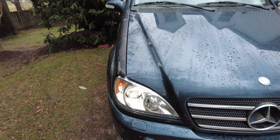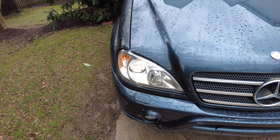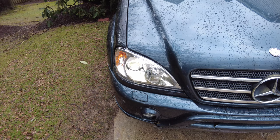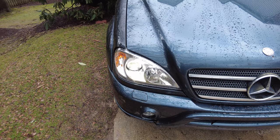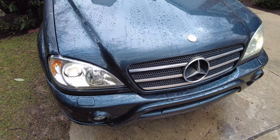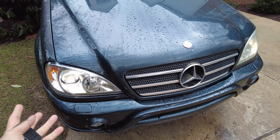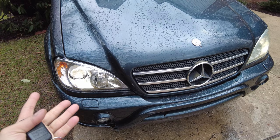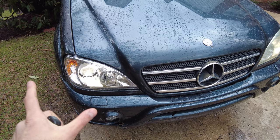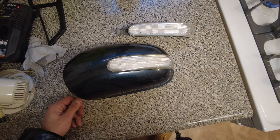When I swapped the good headlight over to this side it still wouldn't turn on, so I knew it couldn't be the ballast. The Xenons don't have a fuse — they come from the AAM module — but I tested the connectors with a multimeter and they had power. Finally I dug in further and saw on the ground wire there are two ground connectors and one of them was for the Xenon unit. I ordered a heat shrink connector repair kit off of Amazon with a crimper and crimped on a new connector, but it still didn't work with the original headlight. So I went and got a used OEM Xenon unit from eBay for around 200 to 250 bucks — a new one from Mercedes is $1,200 and there's no aftermarket Xenon unit available. This one looked basically brand new with a perfect ballast. So it was a combination of two issues: the broken ground wire and the ballast.